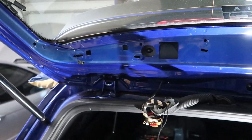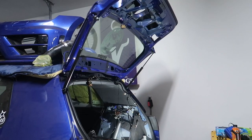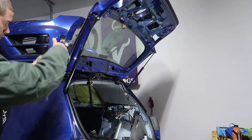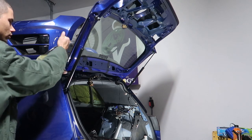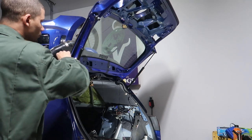The book says there are three nuts to take off the wing. I found one, found number two, but couldn't find the third. Then I noticed a little cap - pulled it off and the third nut was in there underneath it, protected from the weather. So I took all three nuts off and the book says the wing just clips on - press it up with the hatch closed to pop it off.